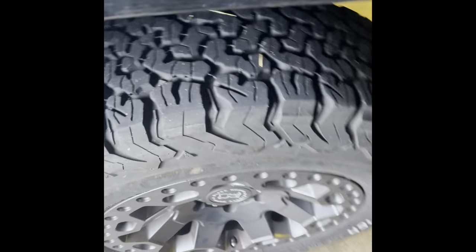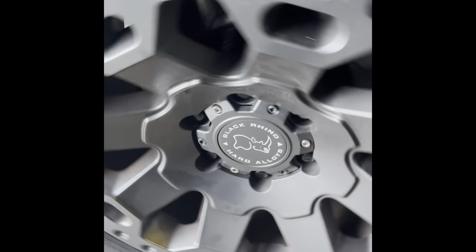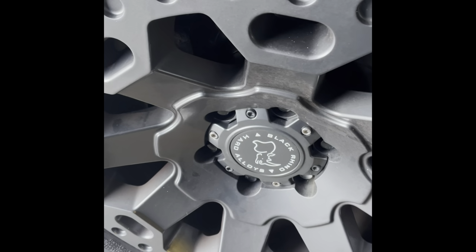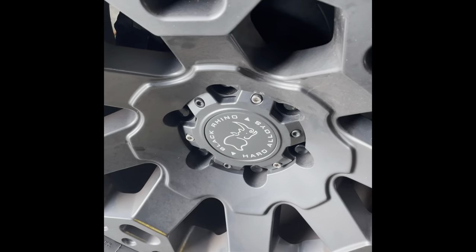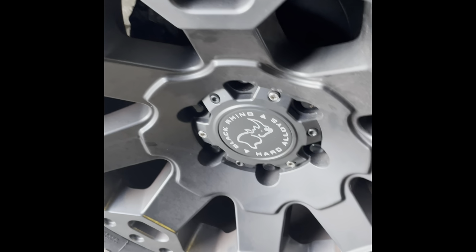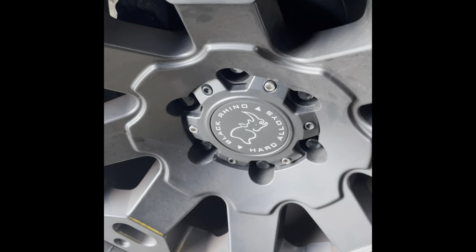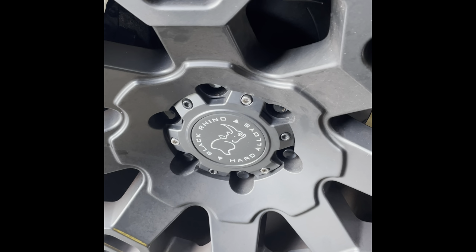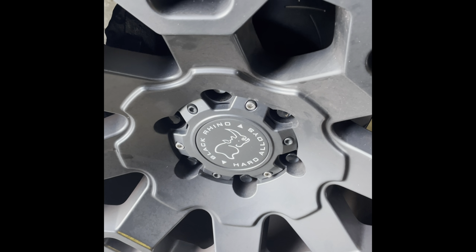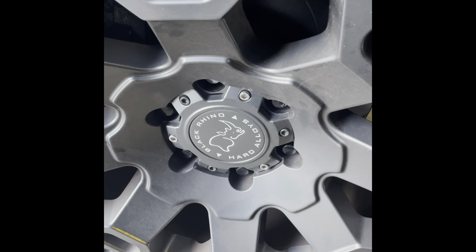Okay, wheel's back on, all bolted up. I'll torque it down properly when I drop it down on the floor, but she's running okay, nice and free, no dramas there. Get these bedded in now, and then once I do the other side, go for a little drive and start bedding the new discs and pads in and see how these get on. I'm hoping, to be honest, that how badly rotted that dust cover was on the back is possibly what was causing the issue with the scraping sound,